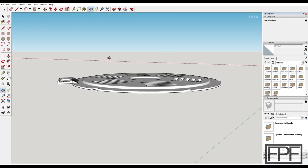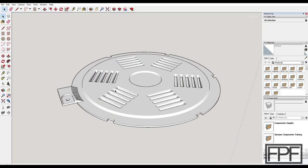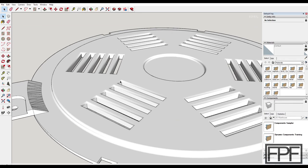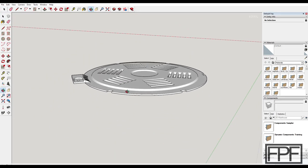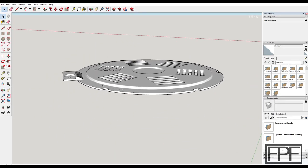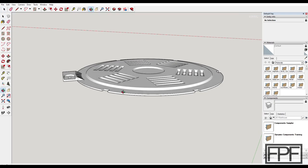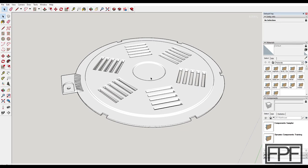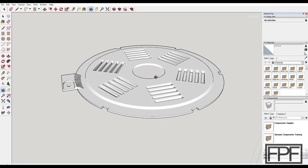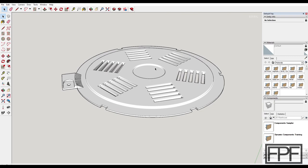I did round most of the edges on this, including the vents, both for aesthetics and just to make it so that air flows a little bit easier in there. The difference in height of the outer ring that locks into those feet is important because this needs to lock under those rings. The center is really also just there for aesthetics, so I just followed the design of the original — but you could knock that out and just leave it one solid area if you want. That would probably cut the print time down by a little bit.